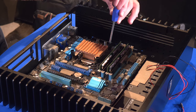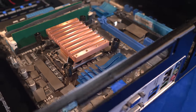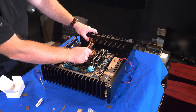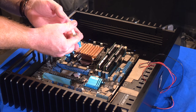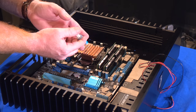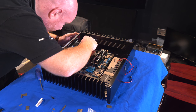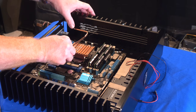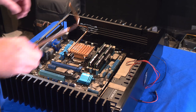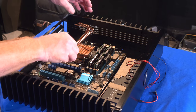We've got eight heat pipes, which is the really clever bit about this design — they run from the top of the CPU to the side of the chassis where the cooling fins sit. You can make them look really neat, but I just grabbed them and got them all to fit nicely. I applied thermal compound to the block where the heat pipes sit, and also to the side of the chassis. I made a bit of a mess of that — I'd say to anyone taking this project on, take your time and do it neat.